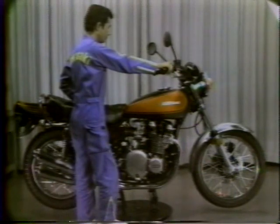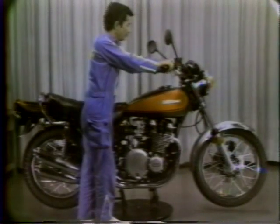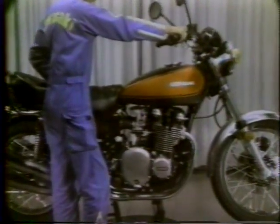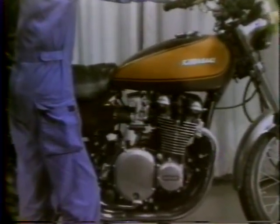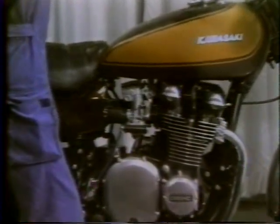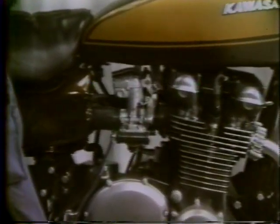If the idle adjust screw, carburetor throttle stop screw, or the air screw is maladjusted, the engine idle will be unstable, engine response to the throttle will be poor, and there will be a drop in performance. Before trying to make a good idle adjustment, check lifter clearance, engine oil level, the spark plugs, ignition timing, and cylinder compression.